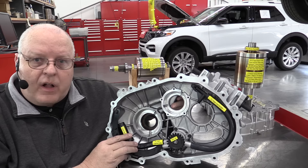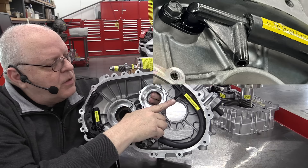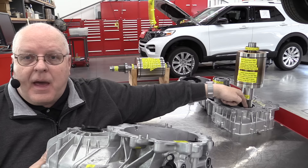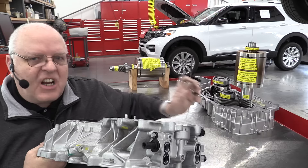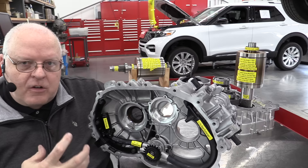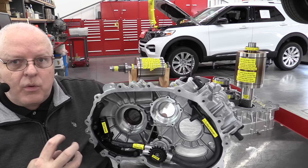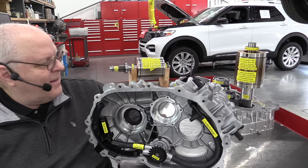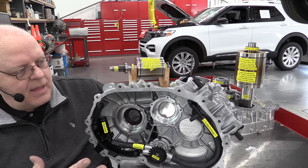Following the output of this pump: it pumps fluid up and sends it to five — actually six — different things. The first place is through a little tube that sprays lubricant on this rotor's bearing and gear — the drive gear with 31 teeth and the bearing that has to support this rotor spinning at 17,542 RPM at maximum vehicle speed. That bearing needs constant lubrication to withstand the higher speeds because at higher speeds the bearing gets hot, the ball bearings expand, and these are special larger-clearance bearings made to expand just a little bit — in micrometers — to allow for that expansion.